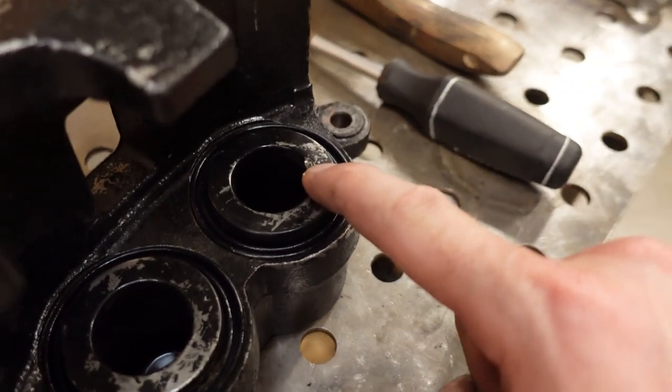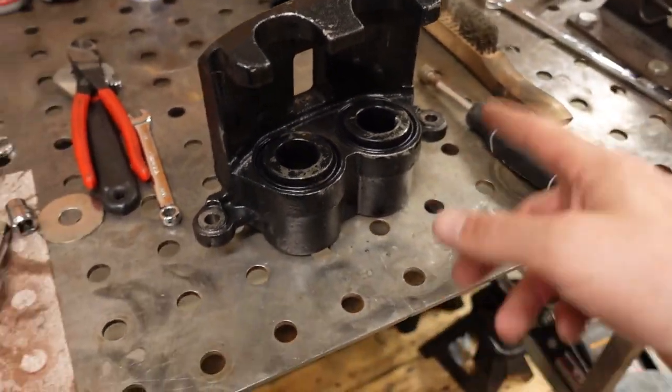You can see that little damaged or bent-over spot where the lump on the back of the pad was contacting the caliper — the piston wouldn't push squarely against the pad and jammed up slightly, giving the symptom of sticking. I ordered another one and threw it on because I didn't love that damaged spot. But once I swapped the pads to their appropriate locations — insides on the insides and outsides on the outsides — everything worked perfectly. The rotor spins freely when you let off the brakes, and we finished bleeding.